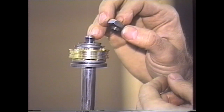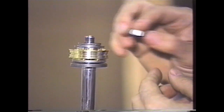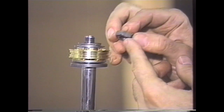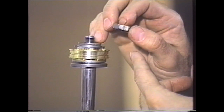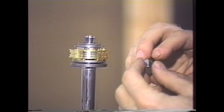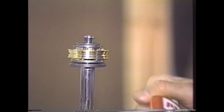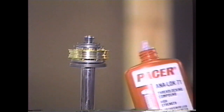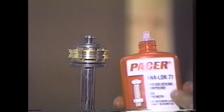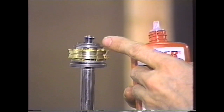Typically Showa is 1.25 pitch, which is a super fine. What you want to do is take a thread pitch gauge and actually check the thread pitch of both the nut and the shaft. If you have any questions, do not do this yourself — have somebody check it out who knows. Make sure everything is perfectly clean, and use Loctite 271 — or a competitor's brand equivalent — which is the non-removable, high-strength thread-locking compound. You must use this and you must make sure that these threads are clean.